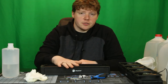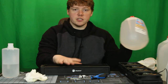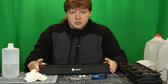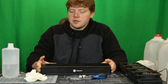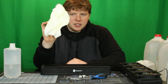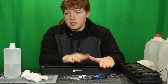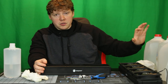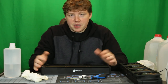After you let the solution sit in your radiator for about an hour, you need to flush it out. Grab another jug of distilled water and flush the entire radiator six to seven times. I did it in the shower. Basically, dump out your solution, leave two ends capped, dump it, shake it a little bit, and then refill it about six or seven times, flushing that out. This mixture, when it mixes with any particles inside the radiator, comes out in a green hue. One way you can tell everything's flushed is once that liquid stops being greenish. Six or seven times uses up maybe a quarter to a third of a gallon of distilled water — that's overkill, but I'd rather overkill it than have a piece of metal in the loop.